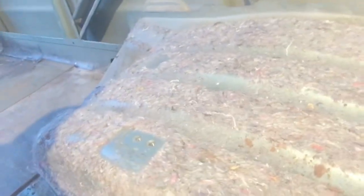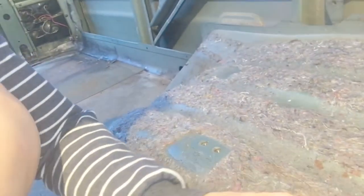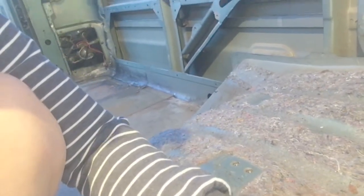It's Sunday morning and my job for today is getting the little bit of insulation off the wheel arches. You can see it's covered in this stuff. We're going to get all this off and then put something on there to stop the noise coming up from underneath the bus as we're driving. Similar process to taking the glue and insulation off the ceiling — we're going to spray it with some engine degreaser, then use a plastic scraper. The reason for the plastic scraper is I don't want to scratch into the metal, which could lead to surface rust later. We're then going to get some foil insulation type stuff to put back on there.